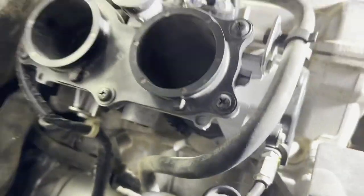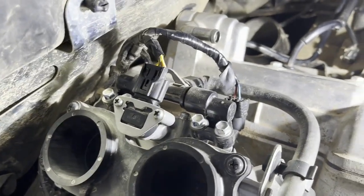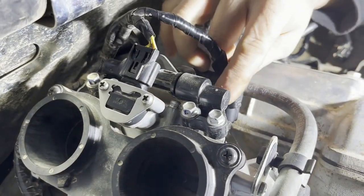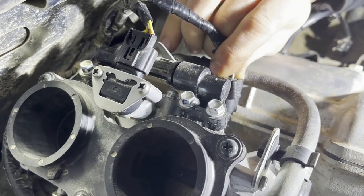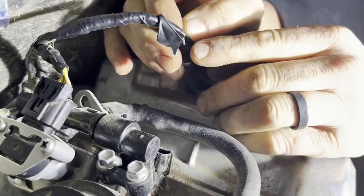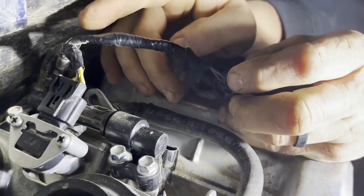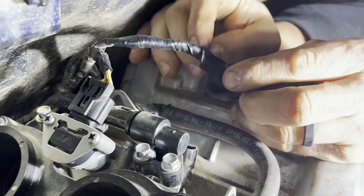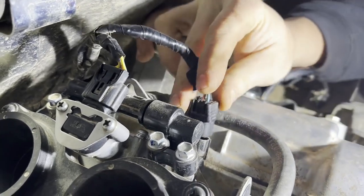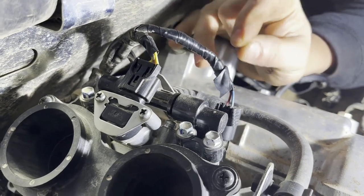So we're going to go back here to the back where the motor's at. On these Pioneers, the fuel injection wires — it is known that in some instances these wires break inside the wire loom itself. So what I done was I cranked the machine up and cut this insulation back and wiggled the wires individually.